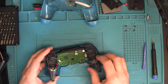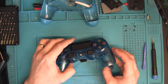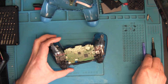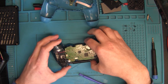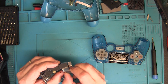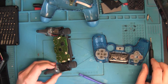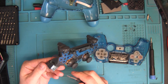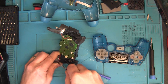That's a good habit to get into — every time you take something off, take a picture of how it was so you can compare it when assembling again. The ribbon cable was stuck in the hole, so make sure that the plastic tab is not blocking the hole. Now we can access the motors and push them out. There is a small adhesive tape holding the motors in the socket. You can use isopropyl alcohol to soften the adhesive if you want — it is fairly well stuck in there but not too bad.